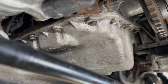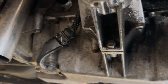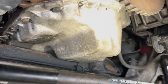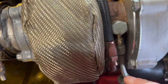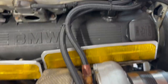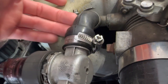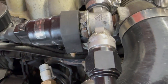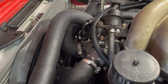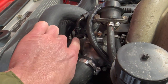While I'm under here, I'll show you the difference in the iX oil pan compared to the rear-wheel drive — it's way shallower in the front and doesn't have that big sump that hangs down. Water cooling on the turbo wasn't as big a challenge as the oil side of things. From the factory, these things have a throttle body heater, which I deleted a long time ago even before my turbo setup. They have two coolant lines that go to it, and I've basically just repurposed those connections for my water cooling on my turbo.